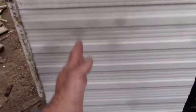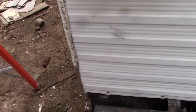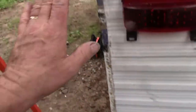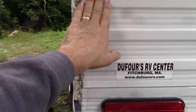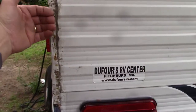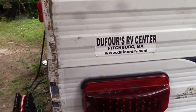And the rear cross member, the metal piece here, that I replaced was just powder. I think I showed that to you before. And it just crumbled. And then the vertical studs that attached to that, the last 4 inches of it were just missing because they rotted out. So that's why I'm going so nuts with all the sealing and the configuration of the side being wrapped around the rear, just to keep the rain from driving down the road and having it being forced into that corner. The butyl tape on the final trim should prevent it from making it any further than just inside that lip.